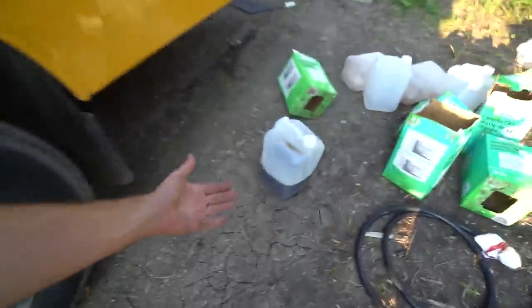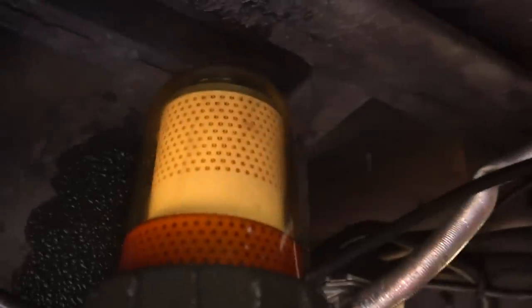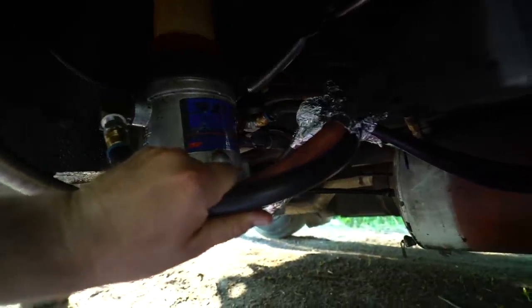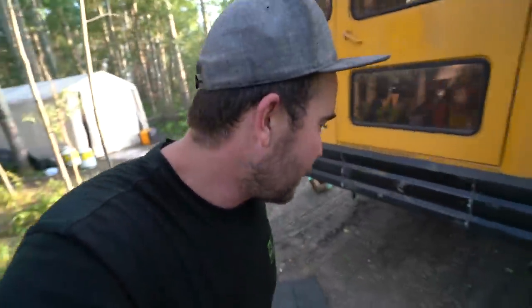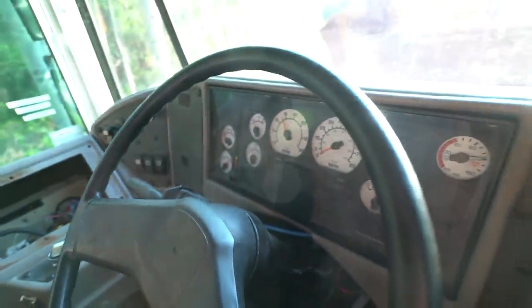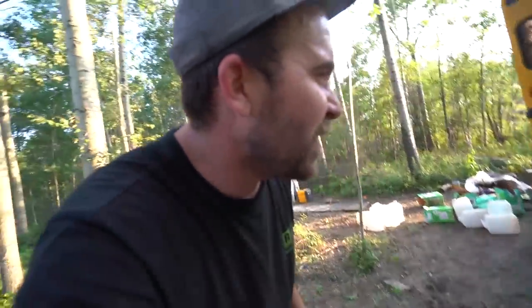This is the color of the fuel right now — that's the oil. Let's take a look at the fuel filter. You can't really tell what color the fuel is going through. It's very hot. I think we did it. I was expecting more of a french fry smell. Let's stand back a bit. That's not diesel fuel — that, my friends, is some french fries. My bus has a high idle feature — so you turn that on, rev up the engine. We've got 1,500 RPMs. We're pushing out some of the fuel to see what kind of odor we get. Oh yeah, that's definitely veggie oil.